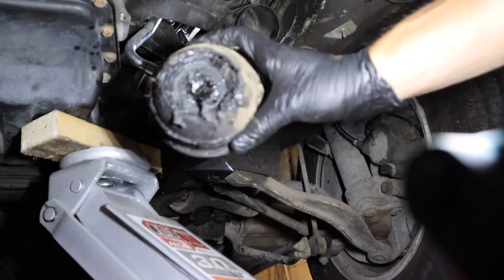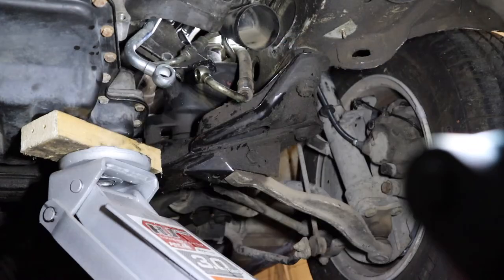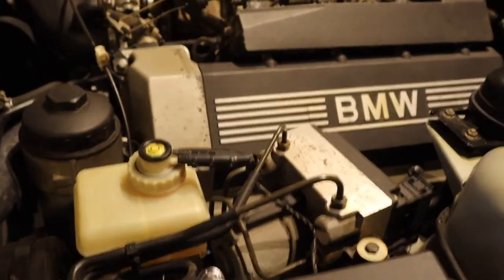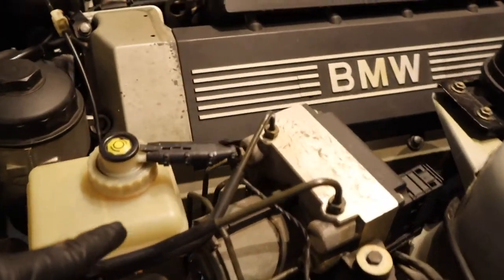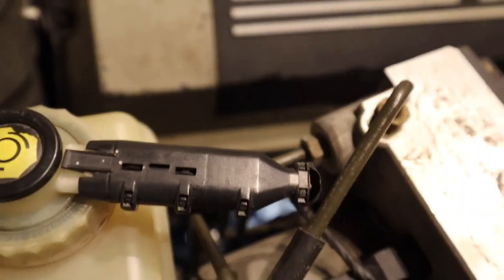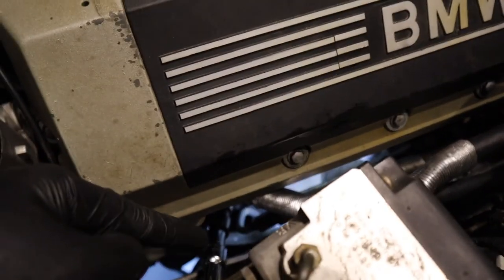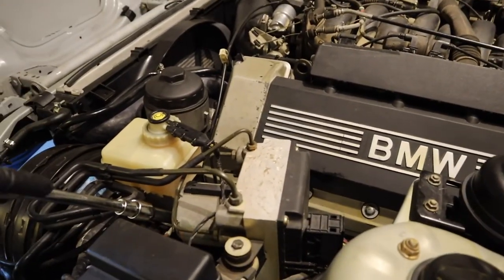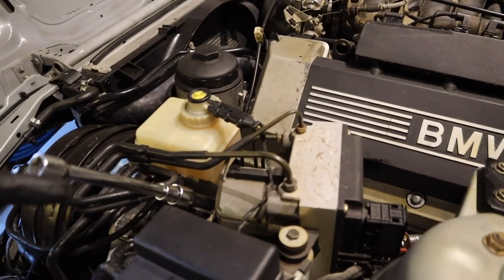This is my shredded-in-half motor mount. Leaking something. So you basically take 17 extensions and go kind of in between the power steering reservoir and the engine. Now that it's nicely raised, all the way down there — there's no way you're going to see it — down there somewhere is the top of that bolt. Now what I'm going to do is basically rotate this, get it undone, take it out of the way, slop in the new one, and repeat this process.